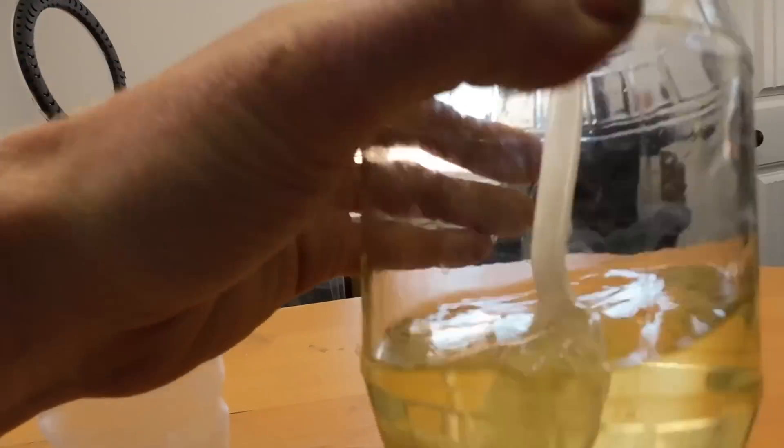You can see some granules on the side of the bottle and the sediment in the bottom. A friend mentioned they coat the inside of those gas tanks with zinc, so I think a lot of the residue could even be from that. But the fact of the matter is, sugar did end up in my tank — someone doesn't like me, I guess. Luckily, sugar in the gas tank doesn't actually ruin the engine. All it does, as seen from this test, is plug up the fuel filter. And as I showed earlier, none of it was getting past the fuel filter, so I'd say we're good. I was not expecting that — it was kind of the last thing on my mind because I had just gone through the fuel system not too long ago and kind of ruled that out early on. But after enough of you guys commenting, I decided to check it out.